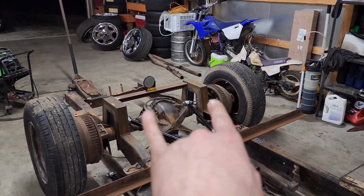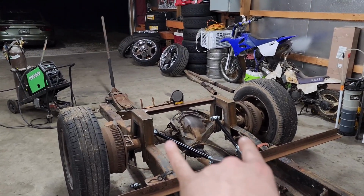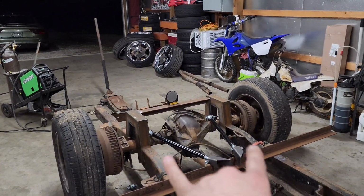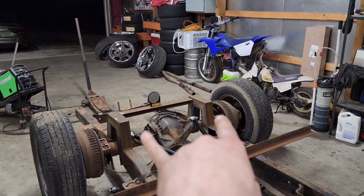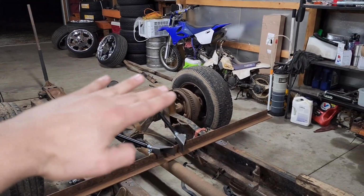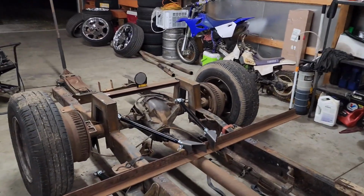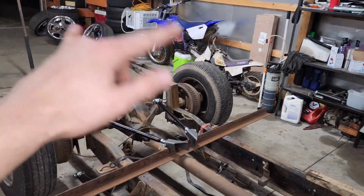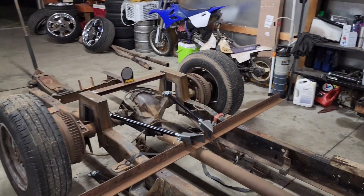So this is going to put my bars down lower at a better angle so I can run them kind of parallel, within like 1 degree of the lower bar, 2 degrees maybe. And then they're going to keep them down low below all this. If anything, I might just have to slope the bed down, like a 45 plate up, come over and hug the back. And I'll probably make the plate in the bed removable, so if I need to service or adjust any of this, I can.